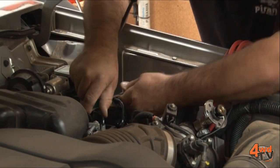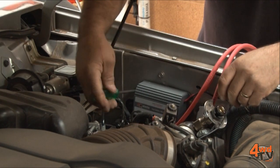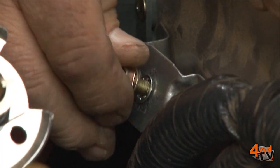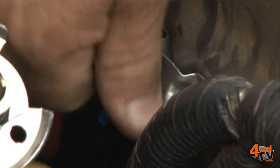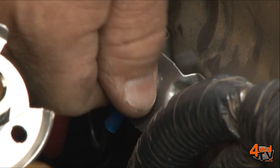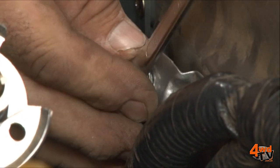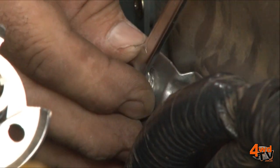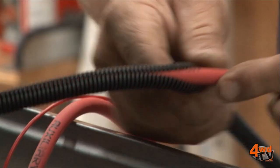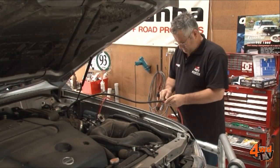We've found a level spot to mount the isolator to allow enough clearance for the bonnet strut. A lot of people make that mistake where the bonnet strut actually hits the unit, so just be very careful there. Next we're going to earth the unit. A lot of people put the earth under the mounting screw which is on top of plastic — that's not the correct way. You need to find a nice earthing point, preferably a captive nut, then clear the paint off, put a terminal on it, screw it on and you've got a great earth. All our cables we run in conduit — convoluted split tubing — to give extra insulation so if it rubs through anywhere it won't hit the copper cable and cause a short.